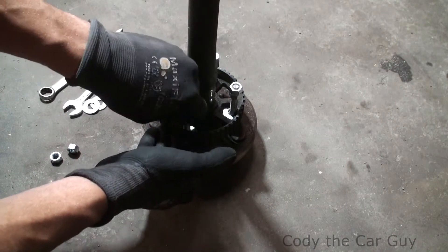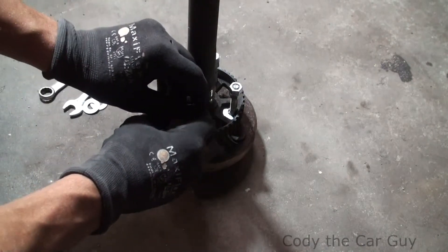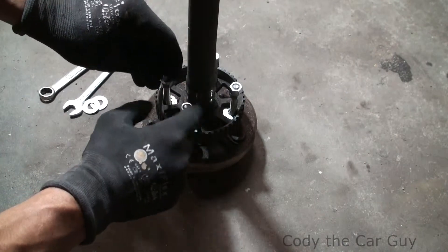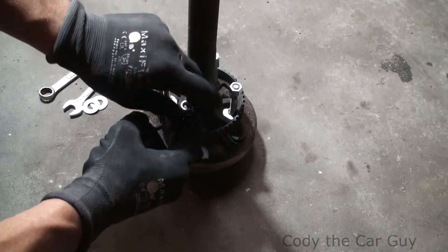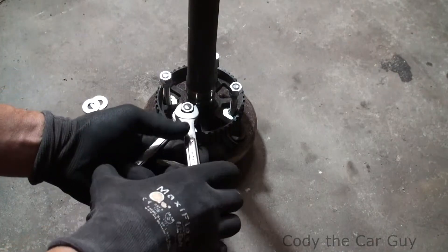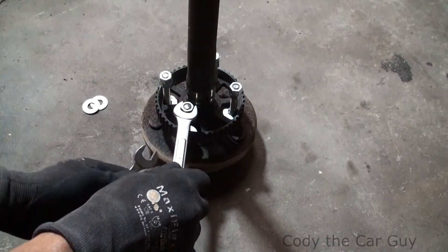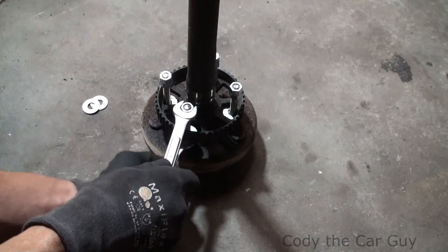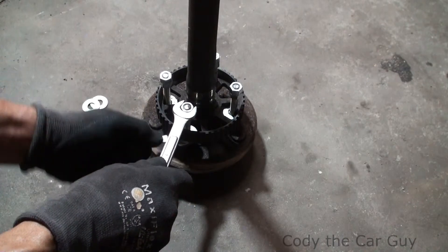Come in like this, put it right through the washers, put one of the nuts underneath and thread it in. You want to make contact with the flange of the axle — as you see, it's holding up like that. Now come up to the top and make them flush. Take two wrenches and tighten them into each other just like that. Keep one up top and come down to the bottom and start threading up.